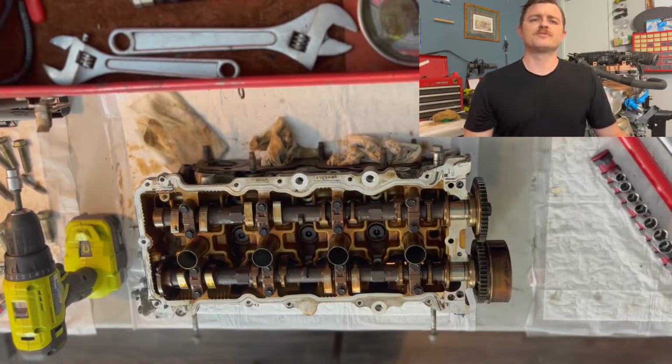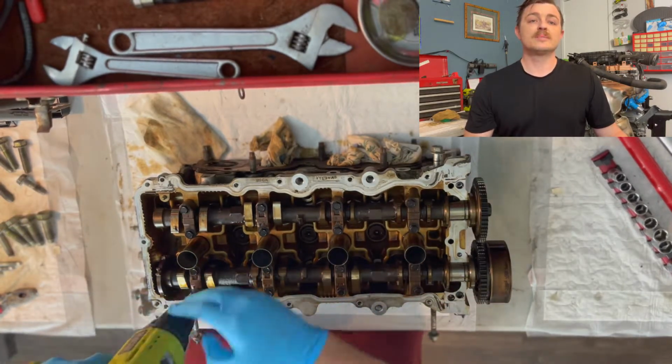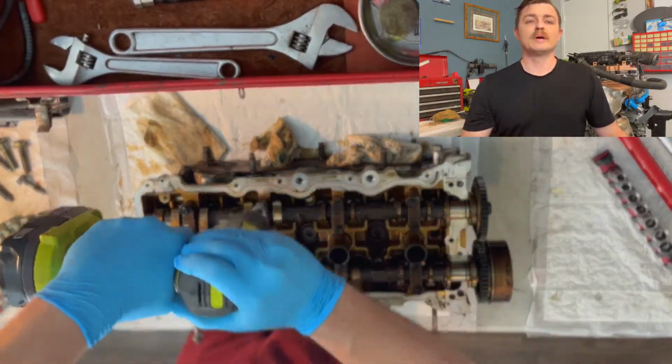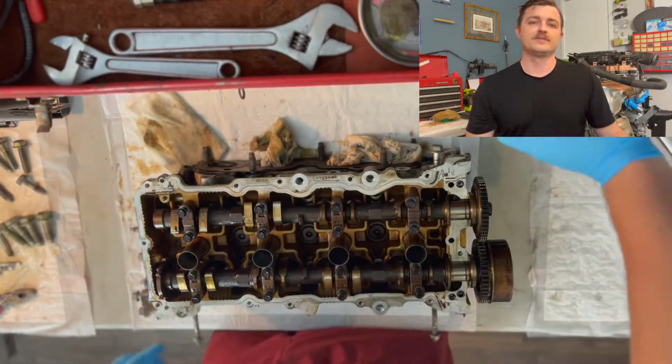We've just got the measurements from the feeler gauge and found all our current valve clearances. I've used the micrometer to measure the thickness of the cam buckets to make a point to y'all at home. You'll see what I mean. The buckets are stamped with their metric measurements. In this example, I measure an 808 bucket. We'll do some quick math soon.